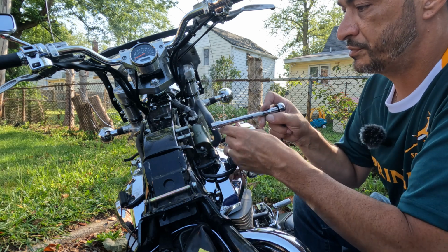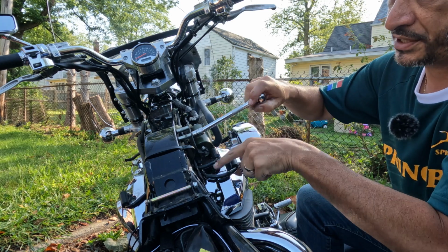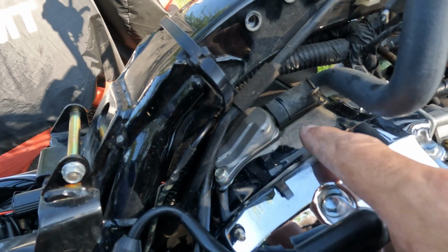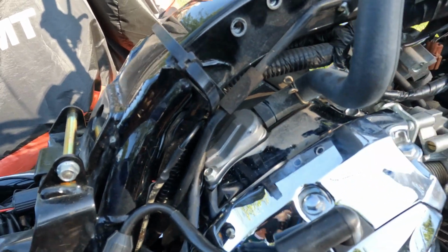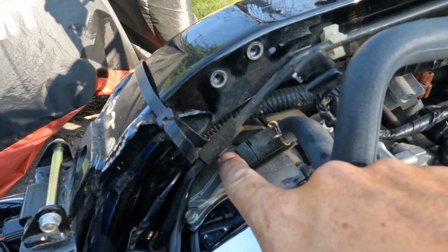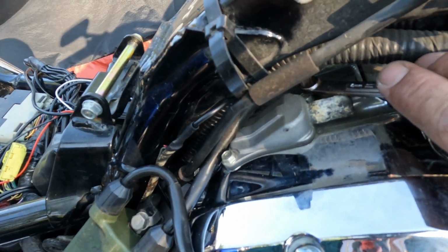All right, I'm just going to start with getting this little solenoid out of my way, and it'll give me full access to get in to the actual pair valve. So the easiest way is to pull the little tab off and pop this off here first. It's probably stuck like mine, but just give it a twist and pop this off, because then you're going to have more room to get to that back bolt that's way down in there. So now that that's out of the way, I can get my wrench in there a little bit better.